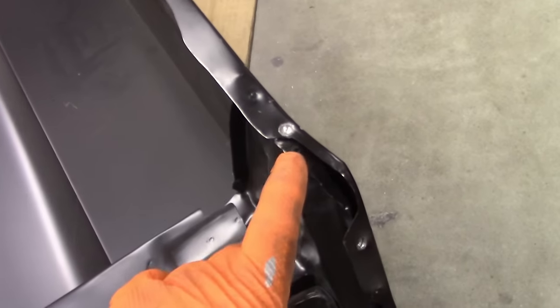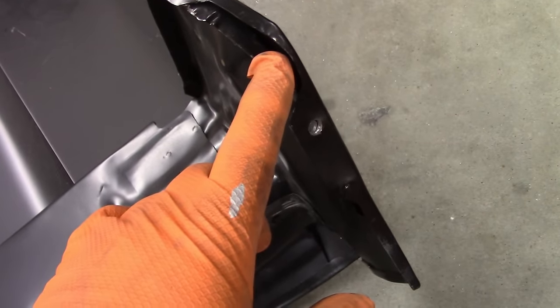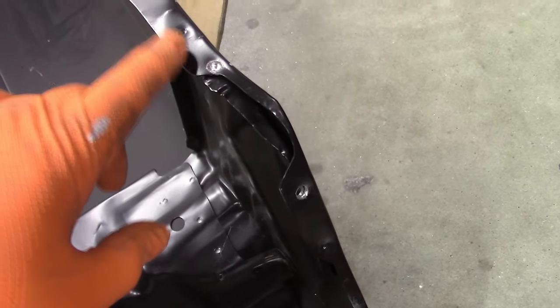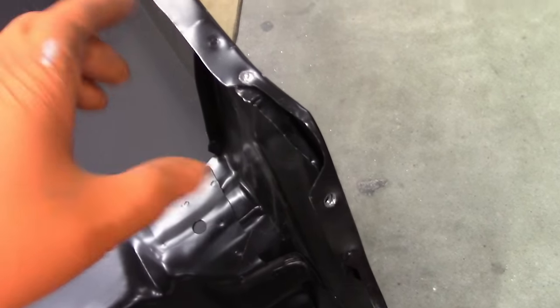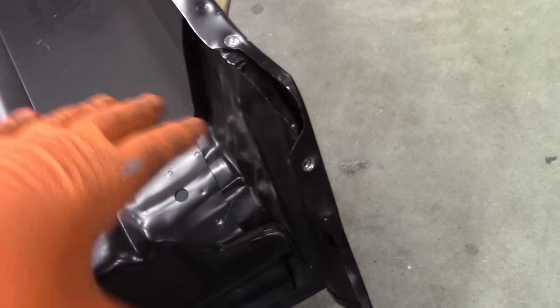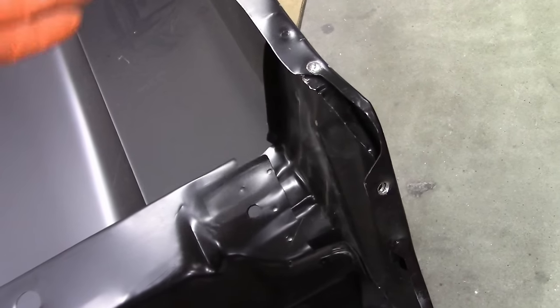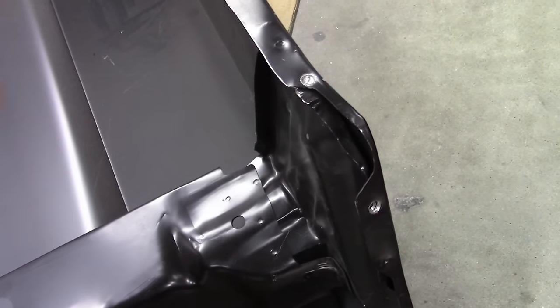On the fender, I had drilled out these spot welds because this corner was kind of low, and I don't want to just force it. Ideally I might have to drill out this spot weld as well. If I get it in place I can tweak this up just a little bit and re-weld these - that way it'll be in a fixed location and not a conflict later. These little details are what you have to deal with sometimes. You have to kind of think backwards, undo some of the stuff that was done previously and figure it out from there.